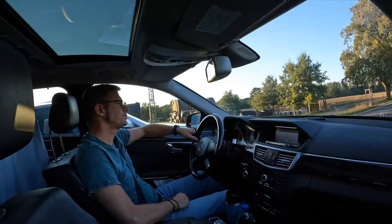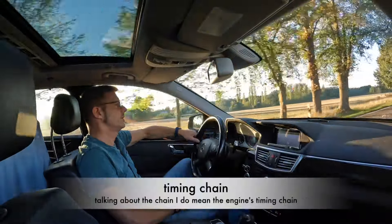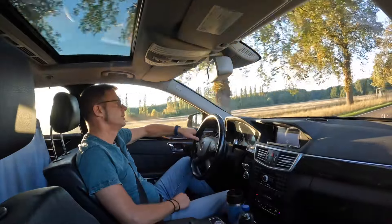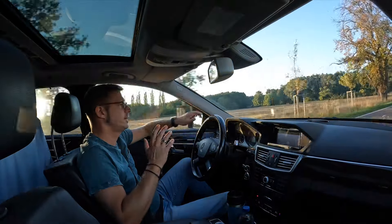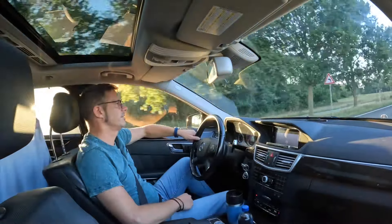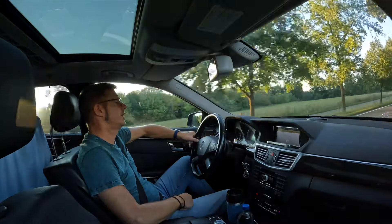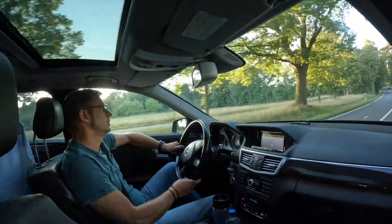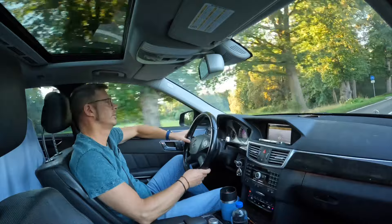What I want to tell you is that I did have an issue with the car. The engine in this car is not driven by a belt but by a duplex metal chain, which usually is good for — depending on usage and circumstances — I would expect around 400,000 kilometers. This car has now clocked 366,000 kilometers, and for a couple of thousand kilometers I did have a chain rattling when I started the car.